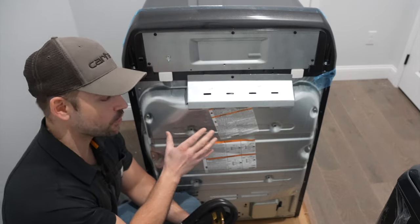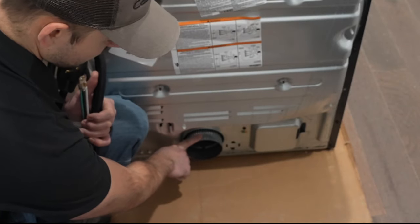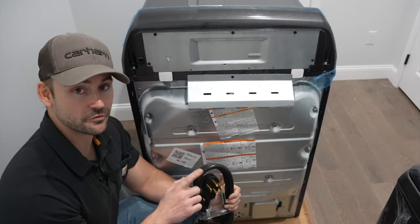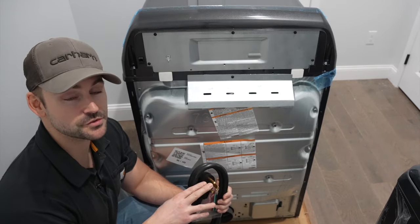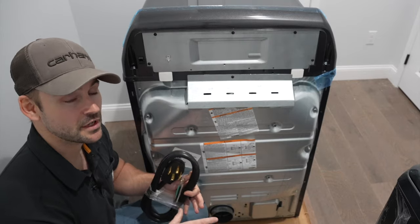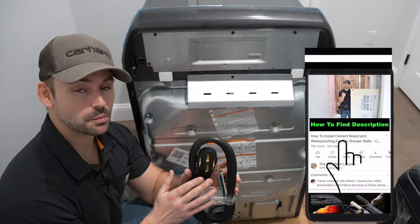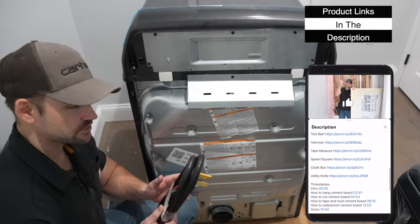I'm now on the back side of the dryer. There are a couple of areas that almost every electric dryer has: we've got our vent pipe and we've also got our junction box where we're going to install our four prong cord. In my jurisdiction I must have a four prong cord and a four prong outlet. In some other areas you may only need a three prong, so I'll briefly describe how to install the three prong as well on this GE Profile dryer. I'll put a link to a four prong dryer cord and this GE Profile dryer in the description below.